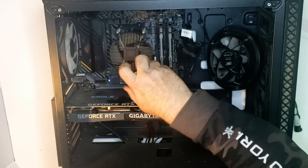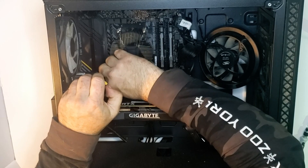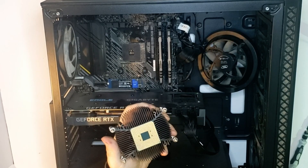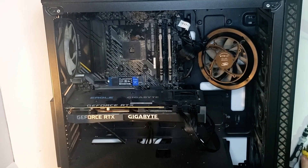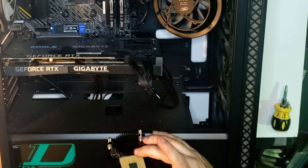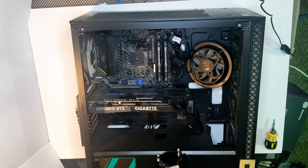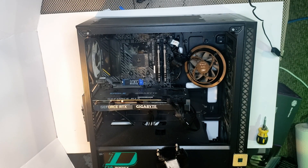Anyways, we can pull the actual fan off now. Not having lost computer parts in your case is amazing. But usually you don't want it on the processor that much — we just pulled the processor along with it. So now we gotta get the processor off here. I hope they didn't glue it on — that would be annoying. Okay, at least we got the CPU off without destroying it. Look at the amount of paste they put on there — that is way too much. We're gonna go get some rubbing alcohol and clean it up — that's your best friend for this.